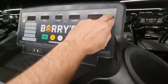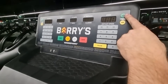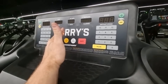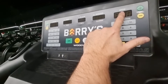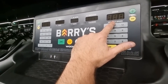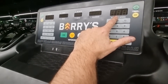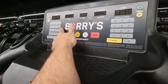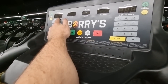So you need to go through that process: hold the speed up and down buttons and press the on button while the screen's off to get into maintenance mode. It'll show you the software, then go straight to that setting. The speed usually says 0.0, but you can also do a belt creep adjustment — that might say 0.1 or 0.2. I do have another video on how to adjust belt creep, so look that up. But this video is more about the incline — on this particular one it was 1.2 or 1.5 or something like that, which means it was already out of calibration.